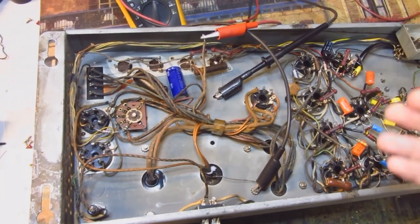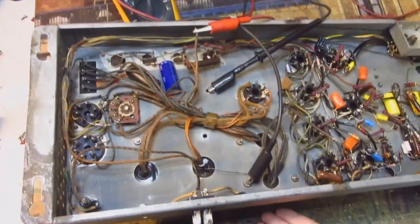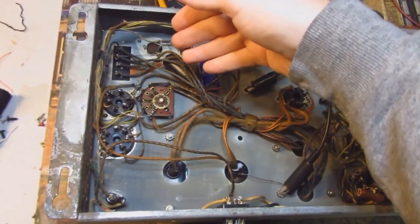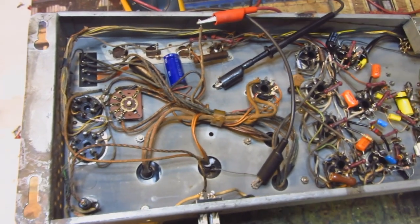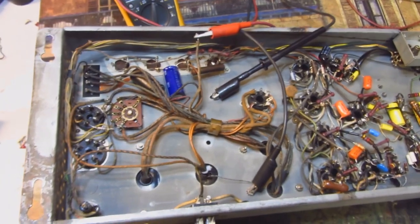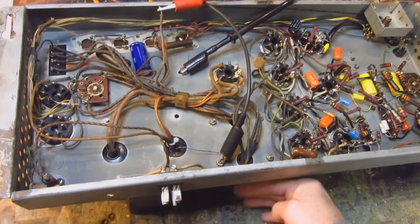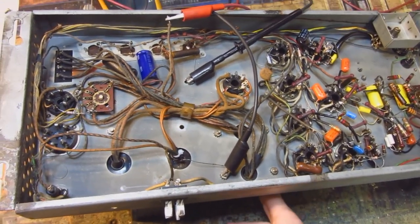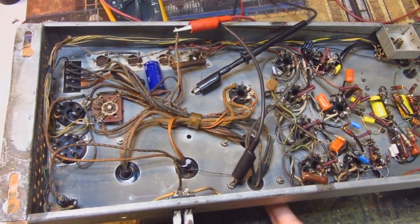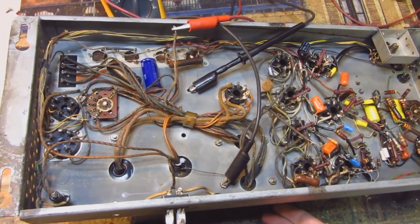Now that we've troubleshot this, we're going to take this transformer off, which is quite a big project because it has all kinds of extra taps for various features — old-style external speakers and things of that nature. So all of this has to get disconnected. We'll pull it out, take the cover off the transformer, and see if we hit luck — probably not. There'll end up being a second follow-up video to this with replacing it with a modern transformer that will work.